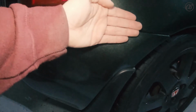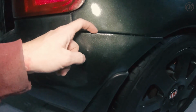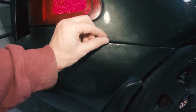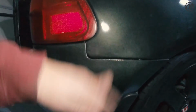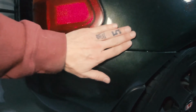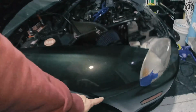that little inside piece here that hangs on the actual car itself, the top of your rear bumper right here, that's what hangs on that, and that's how you keep this tiny little gap right here, if you were curious. I couldn't hold and show at the same time, but you put your rear bumper over that little piece of metal hanging on the chassis itself, and that's what goes onto the bumper. Pretty happy there. That gap is completely gone. This gap is completely gone.